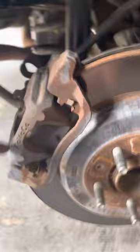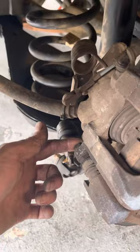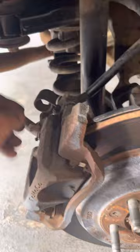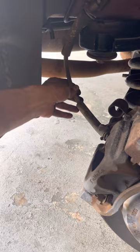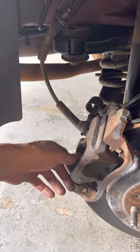Overall, 2009 Lincoln — picked it up for about five thousand dollars, not too bad, pretty clean. I'm gonna order the rear shocks and replace those, and replace these discs like I said. You remove these two bolts right here, then come back here to the bottom bolt. I recommend once you loosen those bolts, get some zip ties, run one through here and zip tie it to something sturdy so it's not dangling down and hurting anything. Be cognizant — make sure your parking brake is off, and safety first.